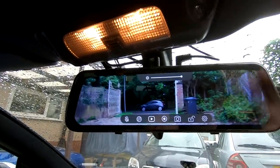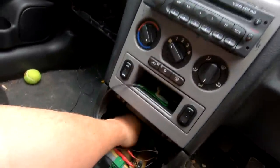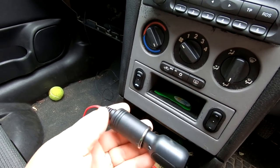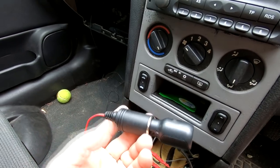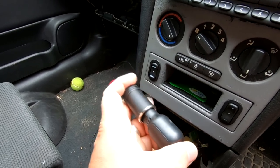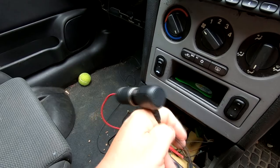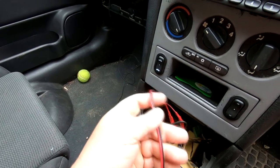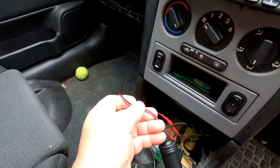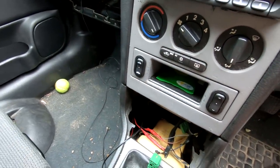Now as far as powering your unit up is concerned — I've left this out here so you can purposely see — I've put in one of those 12 volt sockets you can buy cheaply on Amazon, around two pounds fifty. There's a built-in fuse in there as well. The power lead goes to the actual camera hidden through the dashboard, and I've picked up a positive live feed. You can do it however you want — you can use a cigarette lighter, come in from the back of the cigarette lighter if you wish, and just hide that inside there and put your panels back on.